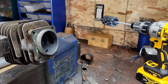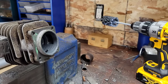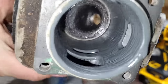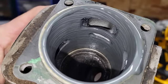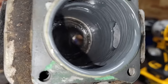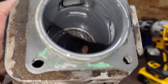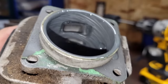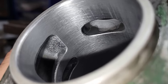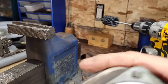Okay, that's it. I'm going to clean this up and let's see what kind of finish these left. You guys can decide for yourself — I hone cylinders, not all cylinders, but I hone cylinders. Look what we got here — nice crosshatch! I can still see some glazing though. Do you want to go further?